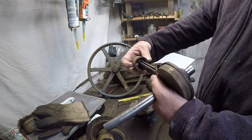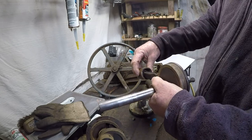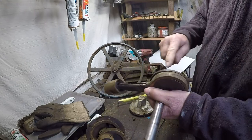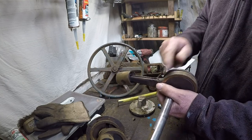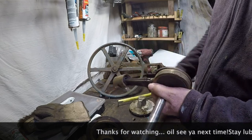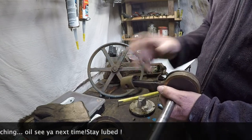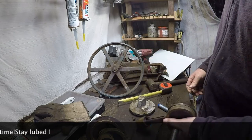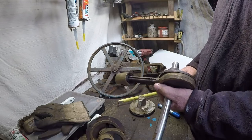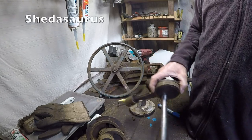The gudgeon pin shouldn't really move in the piston itself — it should stick there — but it needs to move freely on that side. You really do benefit from having this groove, because as the oil is being flicked over, a certain amount will run down, get captured in that groove, and feed straight to that gudgeon pin. Oil is cheaper than parts. Nobody's currently making these things — I've got some molds for them and I'm considering it, but the expense is a bit prohibitive, and I don't want it made in a country that makes poor quality gear.